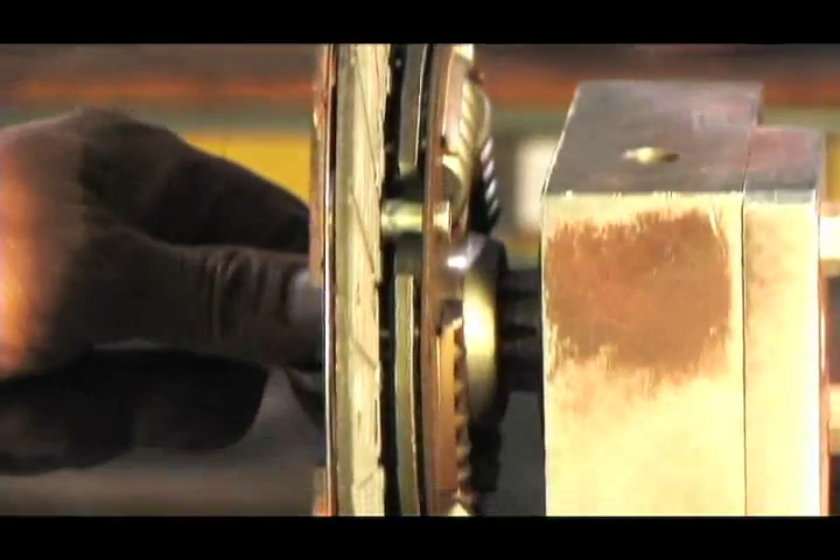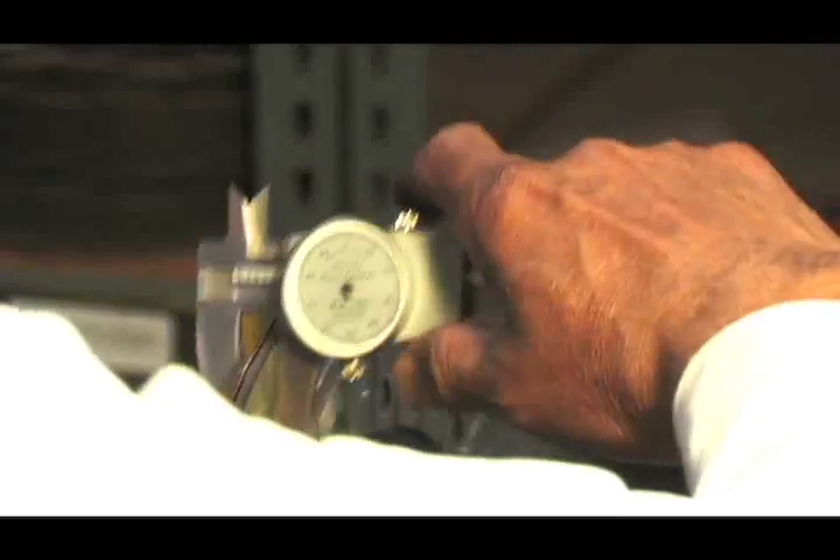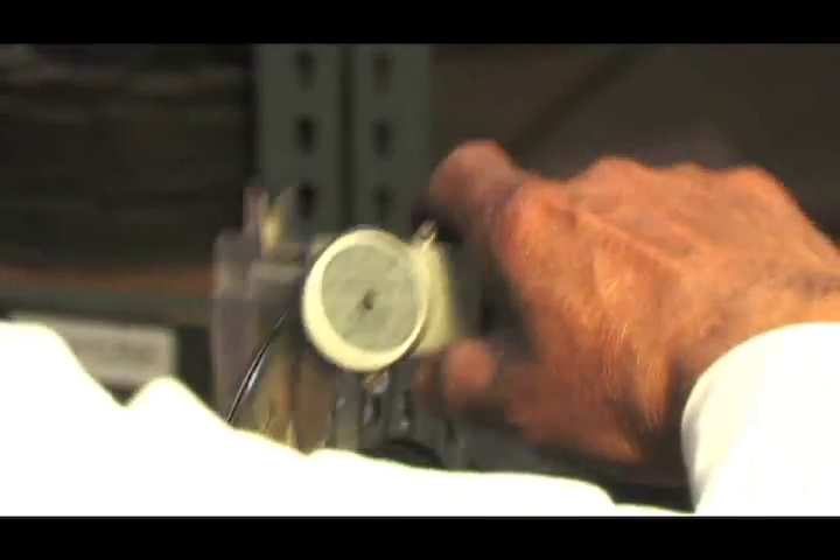This machine has been designed to adjust the marcel by stamping down on the spring steel pads on the disc. There are different dies and settings that tune the marcel in the disc. Once the disc is adjusted and assembled, each one is checked to make sure it's flat and straight before it's placed on an input shaft to ensure fitment.